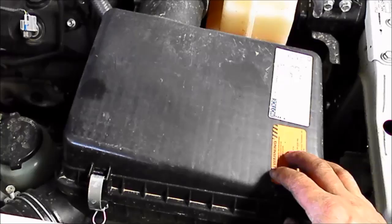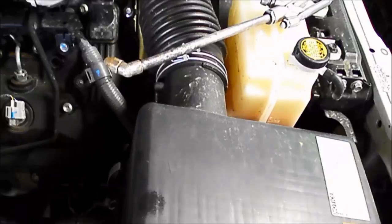We're going to just pop off the air filter here and just blow it out in reverse. The air actually comes in through the bottom so we're going to blow it from the top down — blow out any bugs or grasshoppers that are in there.